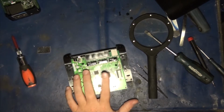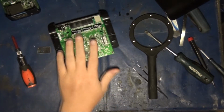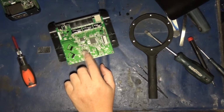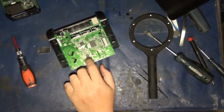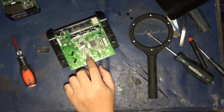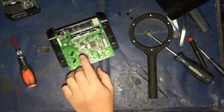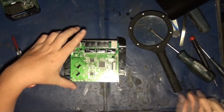This is just your everything else. Now let's look that chip up for a second quickly. Alright, here we go. I got the chip specs up. So, that little Wi-Fi chip there, which is crap. 802.11b, g, and n, 2.4 gigahertz. It says 300 megabits per second, but I've never seen these on here. Supports all sorts of different standards, blah, blah, blah. Now, is it going to say whether it's MIMO or SISO? It does not. But it does claim it'll do up to 300 megabits per second, which I don't think you'll see because this is usually in a SISO configuration.